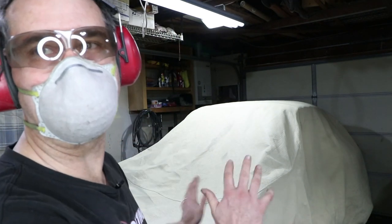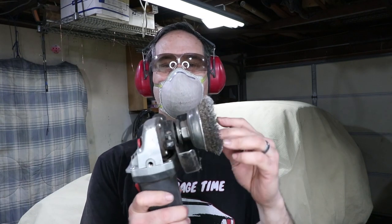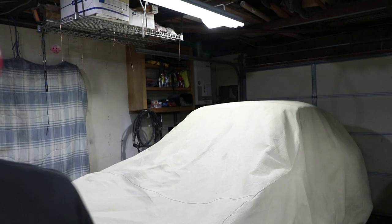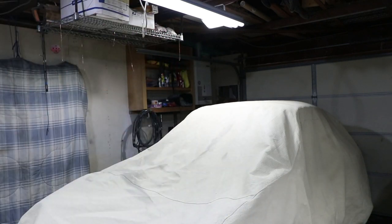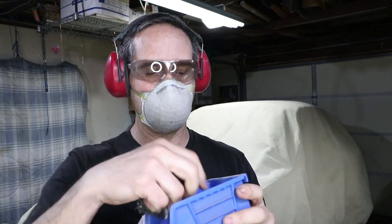I have the car covered in its protective car cover. Some of my favorite tools: this is my angle grinder with the heavy-duty wire brush on it. I have the strip-it disc on the Makita sander — this is good for tight spots. And then for even tighter spots I have these: a smaller strip-it disc that goes on the end of a drill, and then another wire brush. This is going to get all the areas that have been disturbed — undercoating that's either flaking or there's bare metal.